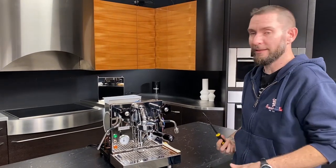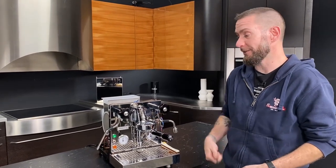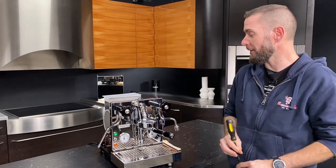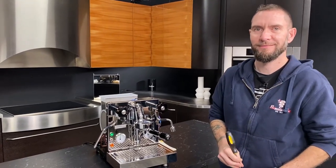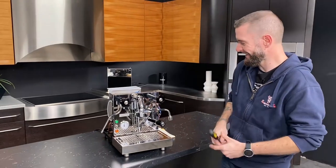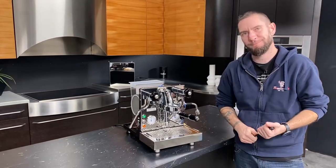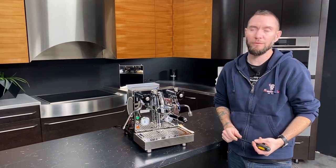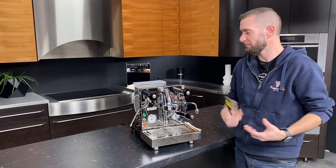But if you let the pump run for a long time like that, I definitely recommend letting it rest for a little while. Yeah, take a holiday for a couple minutes. They call those duty cycles, right? Yes. Like 50% is you can run it for a minute, then stop for a minute or something. I'm not saying that's what the duty cycle is here, but that's the correct idea, though.